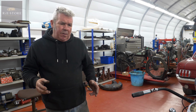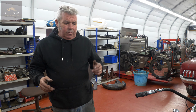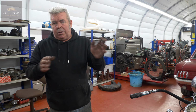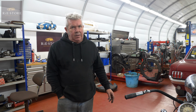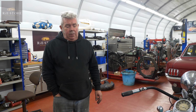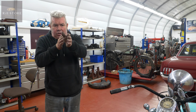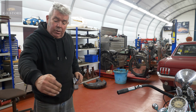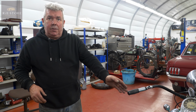So you get some '40, I can't remember whether it was '40 or '41 when they went from the 2-bolt gearbox, but then things really don't match up. All the chains are out of line, all sorts of things. So that's the only thing, if you're getting earlier than '42, realistically. Oh right, okay. You get bits that don't fit this and don't fit that. You can bodge it all together, but it will never run right. It'll run, but it'll never feel right. It'll wear out. Chains are slightly out of line, and you can shim up the wheels to get them in the middle, but that doesn't mean the chain line is going to marry up with the gearbox. Things like that.